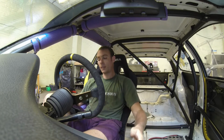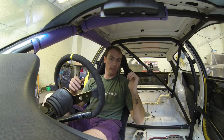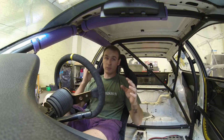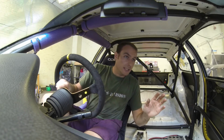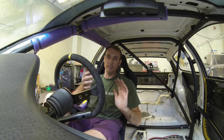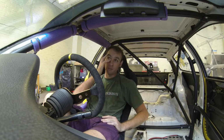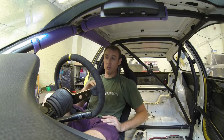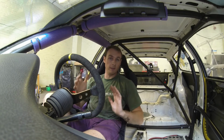So I could look at a carbon fibre seat, helmet, losing some more wiring, lightweight dash, gauges, that sort of stuff. Front to rear again, I can't shift that weight unless I physically add weight into the rear or take weight out the front. Now, people always go on about a 50-50 weight distribution front to rear. Yeah, that's great. However, the way the car comes out of the factory is kind of where you want to be. At the moment, I'm at about a 65-35 split front to rear. Ideally I'd want to be 60-40, which I'm sure I could probably do, but that's the only way you can affect static weight.